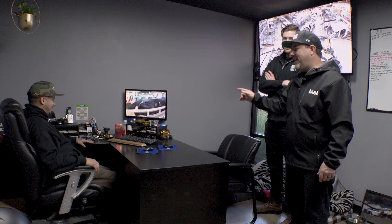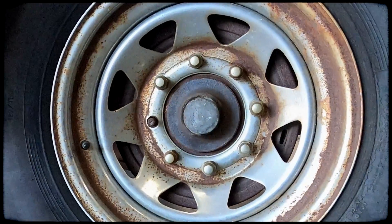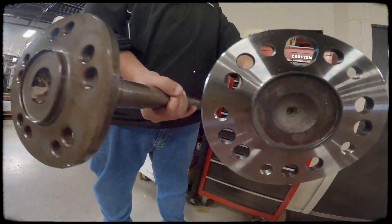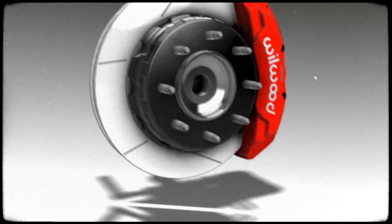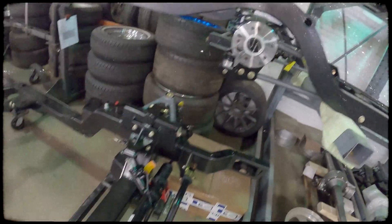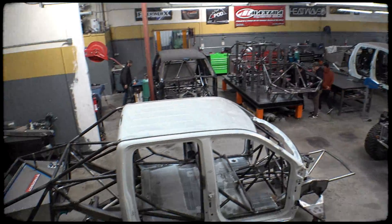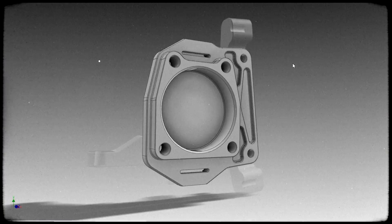So we need spindles. As you may recall, our goal is to keep Lockjaw 8-lug. We had Strange Engineering combine their full floating Ford 9-inch rear end with custom axles and flanges that mate to our GM 8x180 hubs. But in order to mount the GM front hubs and massive Wilwood TX6R brakes, we had to make spindles designed to replicate Wilwood's 5-lug Pro Spindle, which Roadster Shop typically ships with their spec series chassis. So we asked Wilwood to share their Pro Spindle geometry with Kibitech, famous for making 8-lug pre-runners. That allowed them to design a spindle that mounts to the Roadster Shop chassis and would accommodate our 8-lug GM hubs.